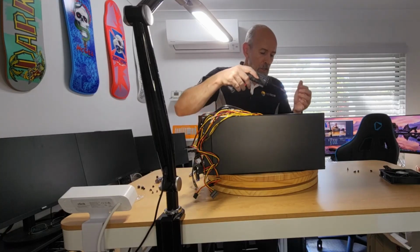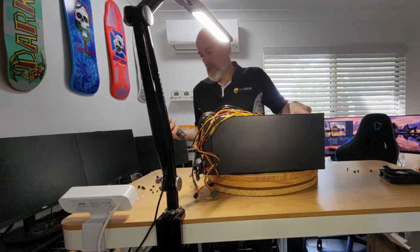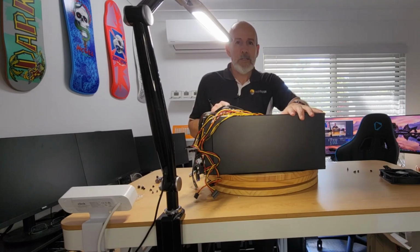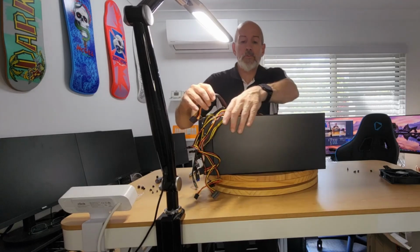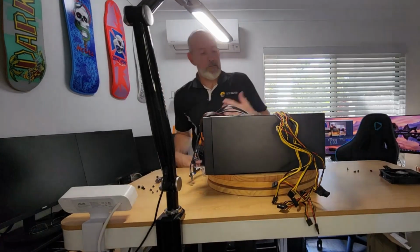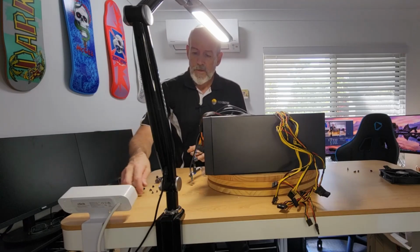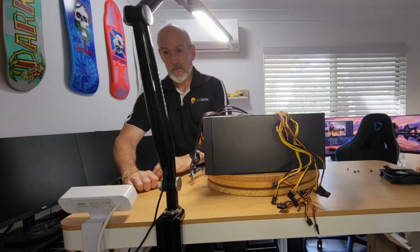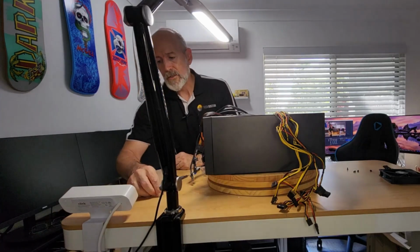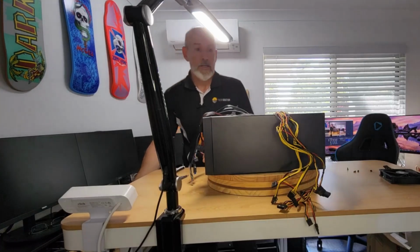And as far as cloning goes, there's a number of different products out there. I mean, there's Cronus, but I use Macrium Reflect 7 Free. It's an older version, but you can clone on the free version, and you can clone a boot drive. So you just stick your M.2 into an enclosure, plug it in via USB, run the clone off the old hard drive, and it takes it across, and then you plug your M.2 in and away you go. So it's really good. But I think the later versions, that's a feature you have to pay for. So if you can get hold of Reflect 7 Free, then that is a much better option.